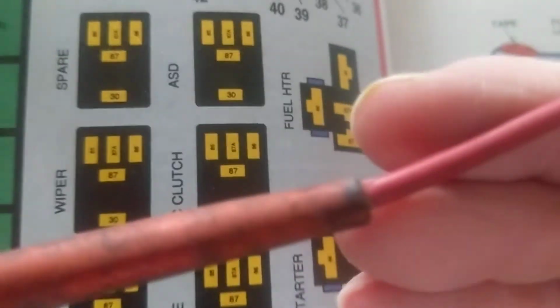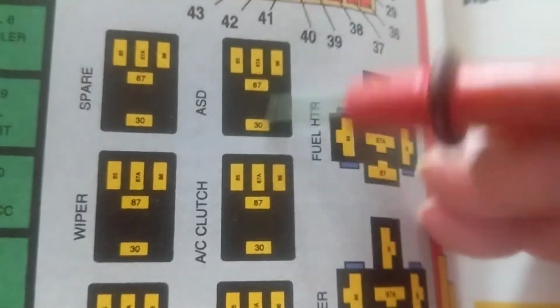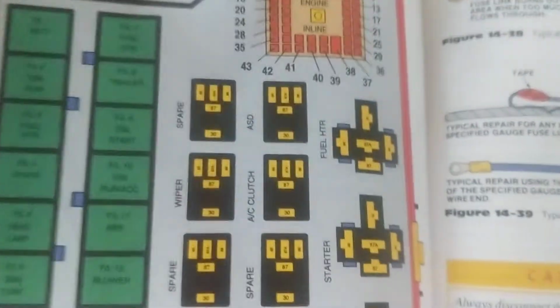But you know what's wrong with that? There are strands in this wire. Strands break off. When strands break off, guess what? It'll end up shorting other terminals that are not supposed to be shorted. Not a good idea either. That's the worst case for me, to take a wire, strip it, put it in here, and have strands all over. Then you're causing more problems.